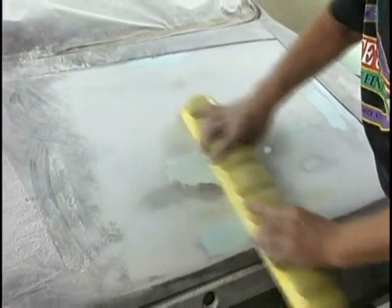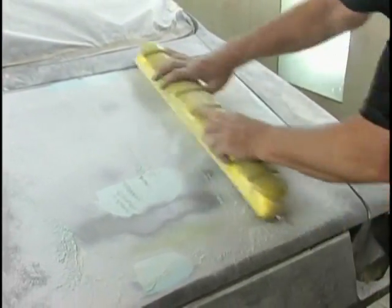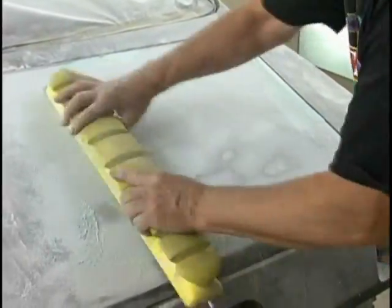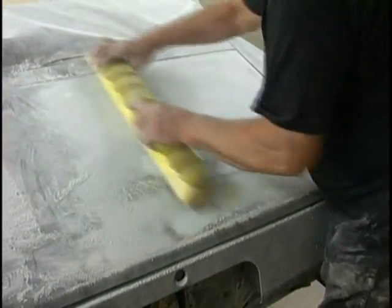As fast as we cleaned our paddle, we're back now with 80 grit, and we're blocking this. You don't have to wait for it to thoroughly cure. If it's not thoroughly cured, many times it'll just seed the paper up. Check your paper and you can tell real quickly whether or not it's cured enough. But it cures in 5 to 8 minutes. It's that fast. Now we've got it. We've filled in our low spots and we're good to go.